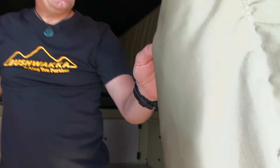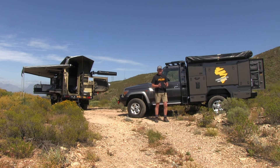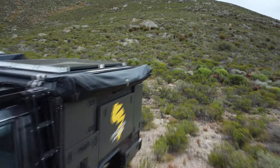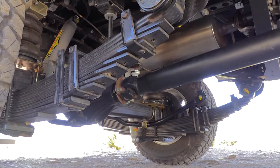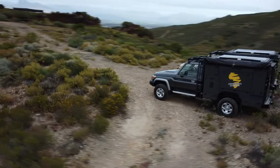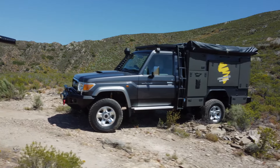There's a canvas door and a net door at the back, and the back door is a solid door that can be used as a security door to keep those noisy lions outside. Key features of our Camelback camper conversions include the construction: the full body is built from marine-grade aluminium — durable, tough, light, and complementing the overall weight of the camper. We use Tough Dog suspension throughout, front and back, aiming for about a 600-kilogram constant-load rated spring on the Camelback with air suspension and upgraded shocks. It drives beautifully and the whole rig's weight is within its GVM.